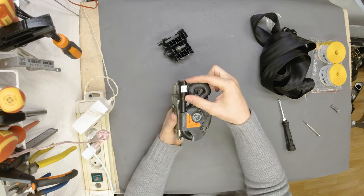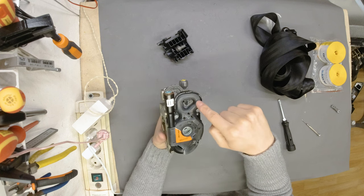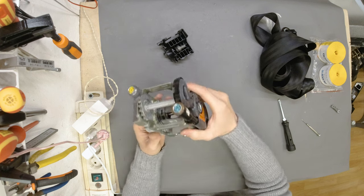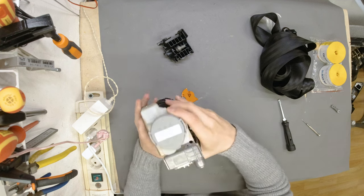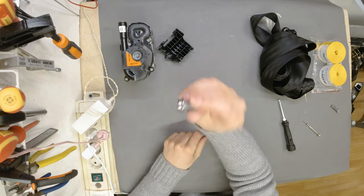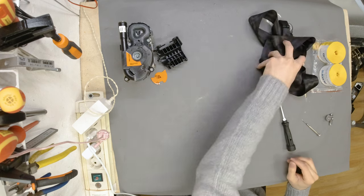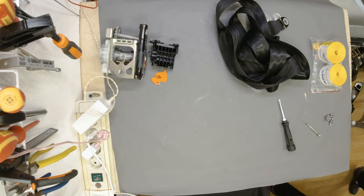This is a pyrotechnic piece that shoots balls to rotate — I think in this direction — and by that it turns this thing around, tightening your seat belt. This thing over here is snapped — it is supposed to snap. There are a couple of gears here but I really don't know how they work. This is useless, this is useless — we do need the screw and we do need the middle piece that locks the webbing into the spool. This goes to trash; this goes to the tailor.